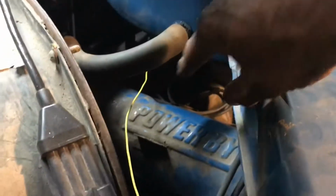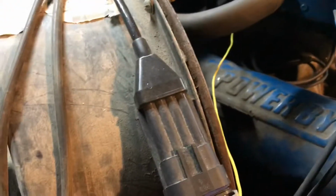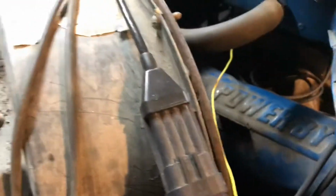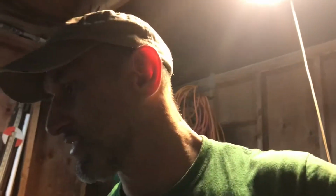Yeah, I got to find out where to hook my O2 sensor. I think it's this cable over here on this side. I'm not sure. We'll get to that. Let me get it mounted. I got a little rubber grommet down there that I can run a line through to keep it off the pipes, because I know on the Sniper forum they say a lot of times people have problems with getting their O2 sensor line burnt, shorted out, and messing them up. So I want to make sure that's back, and then start doing some tuning on it.